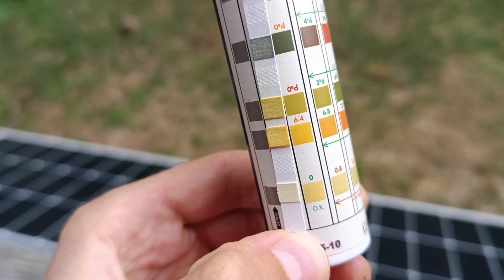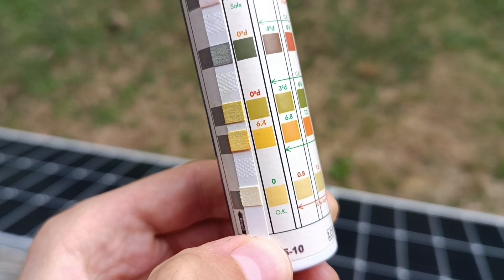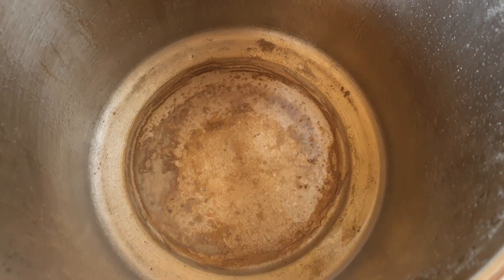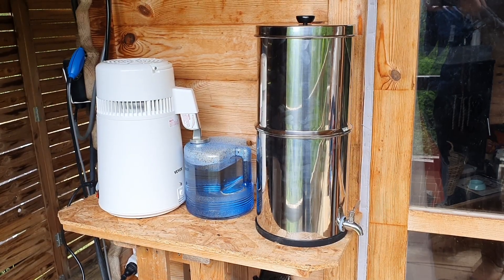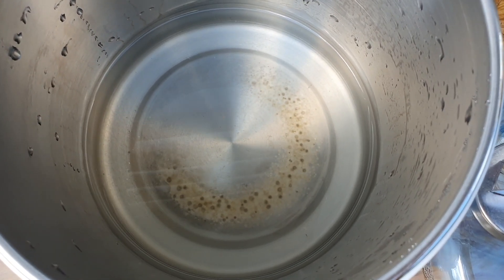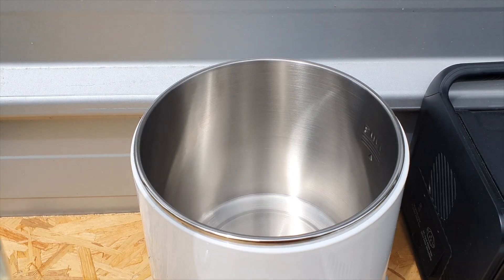The output will be quite acidic, so you need to mitigate that. Working with rainwater, which is already quite acidic — around five or six on the pH scale when I measured it with a basic water testing kit — I recommend getting a kit that measures all sorts of different things so you can check your water quality. When all the water has vaporized and transferred into the container, the distiller switches itself off automatically. However, I recommend leaving a very small layer of water in the tank so it doesn't try to vaporize all the contaminants left at the bottom, which substantially improves the taste.